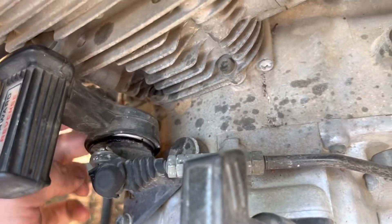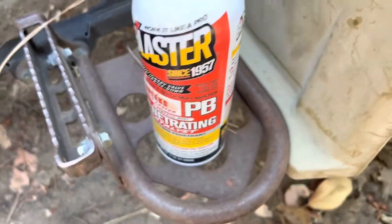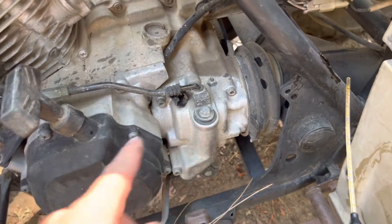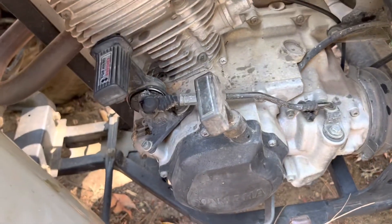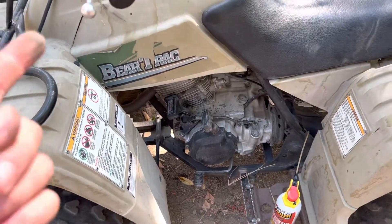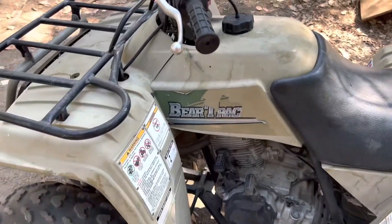Good thing to try — it's just this little rubber boot and a little penetrating oil. Now you don't have to mess with taking this linkage off and figuring out which end it is, because it only takes a minute or two to try this out and see if that's your problem or not. Make sure to like this video, subscribe to the channel, and we'll keep bringing you guys more videos. Until next time!